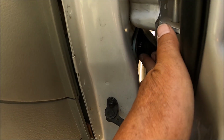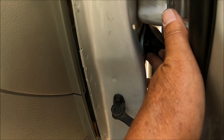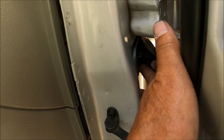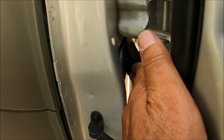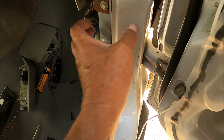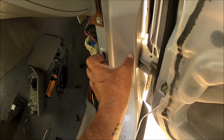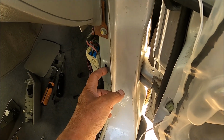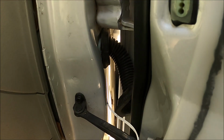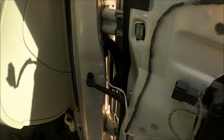So it's right about here. This is the middle bottom, and if you push a wire through there, there's a spot where it'll actually go through, and then just keep feeding it in there, and then down here get your other stiff wire, and there should be enough wire hanging around. It's inside of this cavity here, because over here it doesn't come out, it's stuck inside of here. So then hopefully you can see it or grab it, pull it through here, and then pull the mirror wire with that wire through and down here. So that's what I'm going to do again, and hopefully much quicker than the first time.